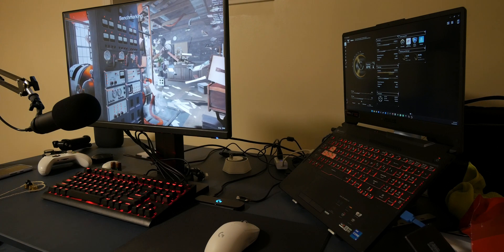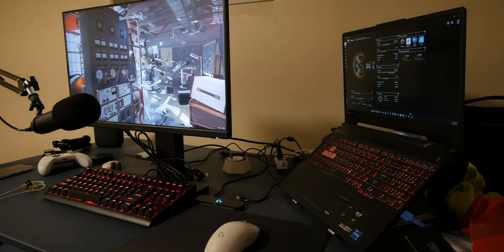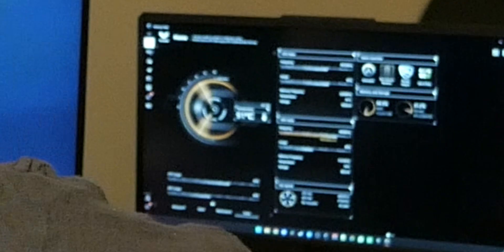Just to give you a brief overview — right now I have a laptop here running Noctua's NTH2 thermal compound that I installed about 15 days ago, and my temperatures are already climbing back up to 95 degrees when gaming. I'm going to do a baseline test with the current setup, then unbox this product and redo the testing. I'll also do a follow-up video once I have longer-term results.